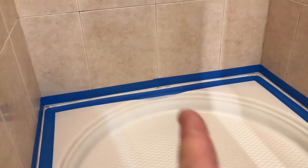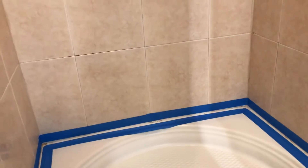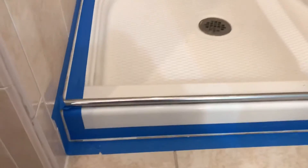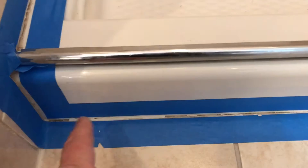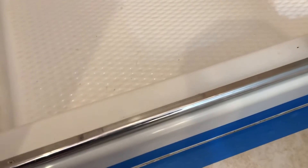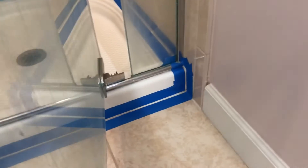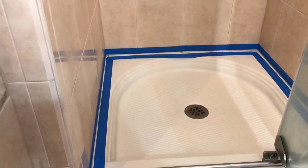I had to go a little bit deeper on that end because there was a little imperfection I couldn't get out — that was from the previous repair. So you just make it a little bit wider. Then you want to come out and tape the front too — tape both sides. When you get to the corners, that's when you utilize your knife to make round corners at the bottom. Make sure it's all down nice, easy, and dry. See my corners here — they're tight.